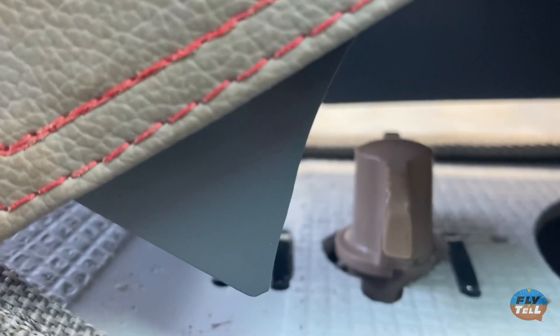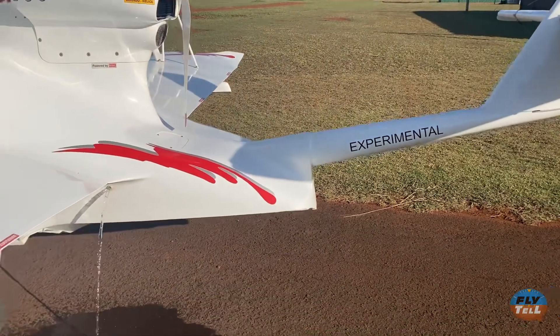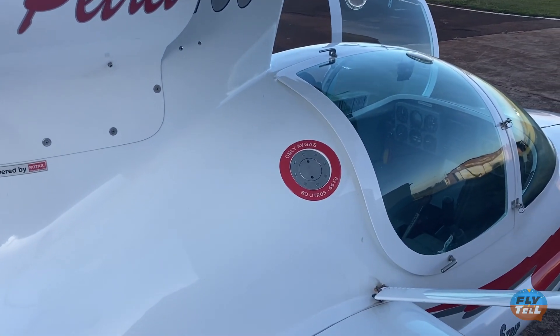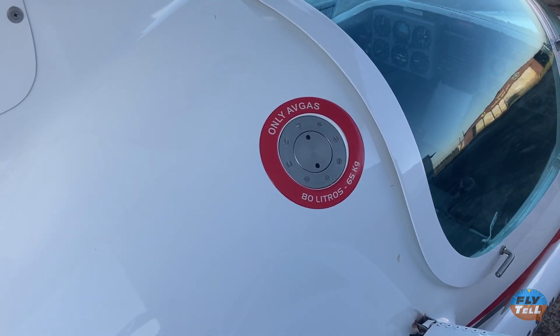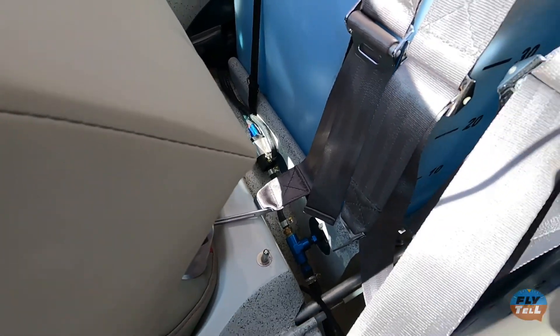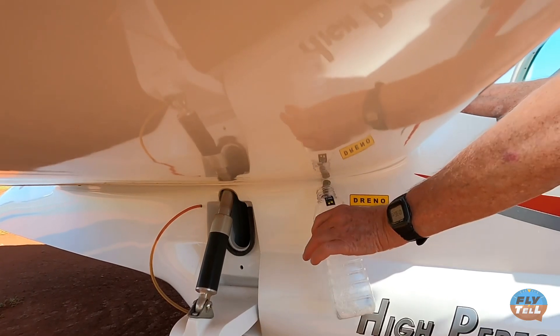To eliminate the ballast, you open this valve and the water drains into the hull, so that you can easily get rid of it with the use of the bilge pump, operated through a switch on the panel. The airplane holds 80 liters, 21.2 gallons of fuel, in two tanks that are located behind the seats. There are no fuel selectors and no shutoffs — managing fuel is simply a matter of making sure there is enough on board. To drain the tanks, there's a pump that forces fuel out the drain valve under the lower right wing.